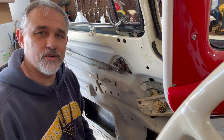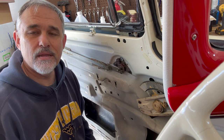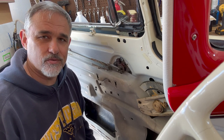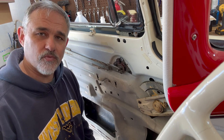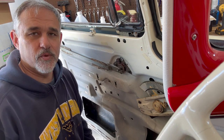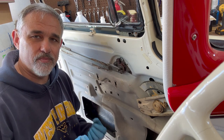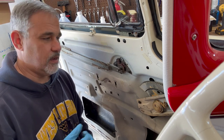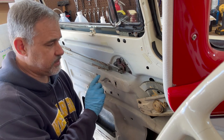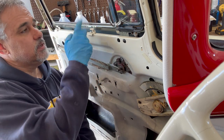I encourage you to use a pick, like a dental pick, something like that. A pick used to get out seals and all that kind of thing, something pretty small, because there's a clip for each roller assembly you're going to have to remove to get all the parts of that roller assembly loose enough that you can pop the pin. Those are the two pins that are part of your scissor mechanism to make the window go up and down.